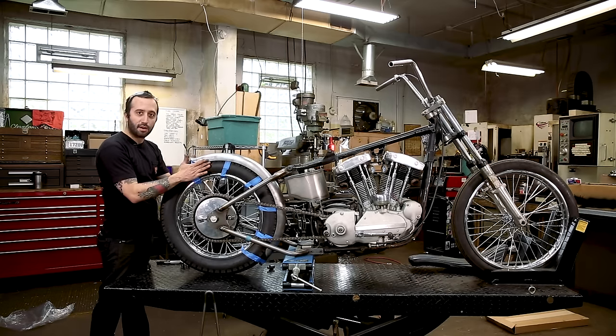So now that this is on there, I'm just going to reassemble everything. I would get this one pretty tight first, just so the materials are sitting flat with each other. Maybe a little bit of play. Make sure everything's still straight. I was looking from the back just from before, making sure the edges of the fender look nice with the tire from the sidewall to the inside of the fender. And everything still lines up really nice from how we were looking before.